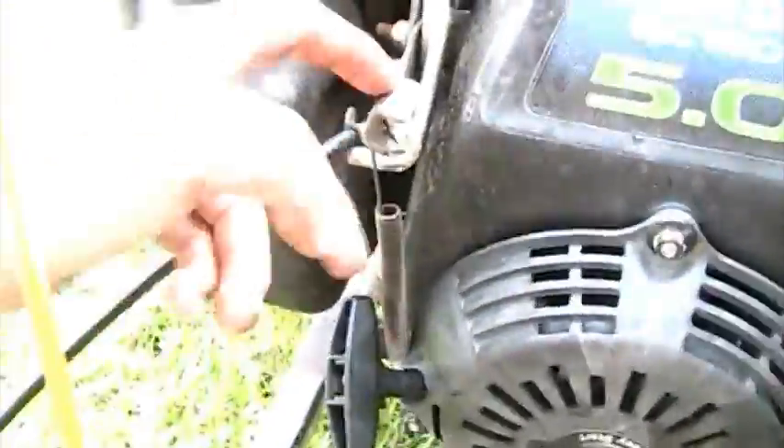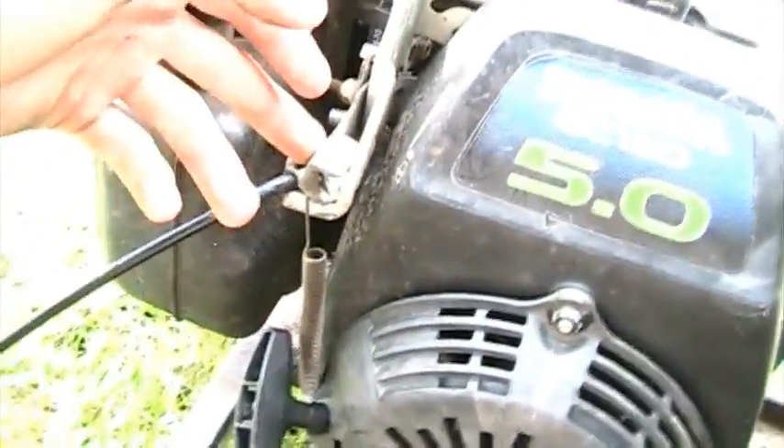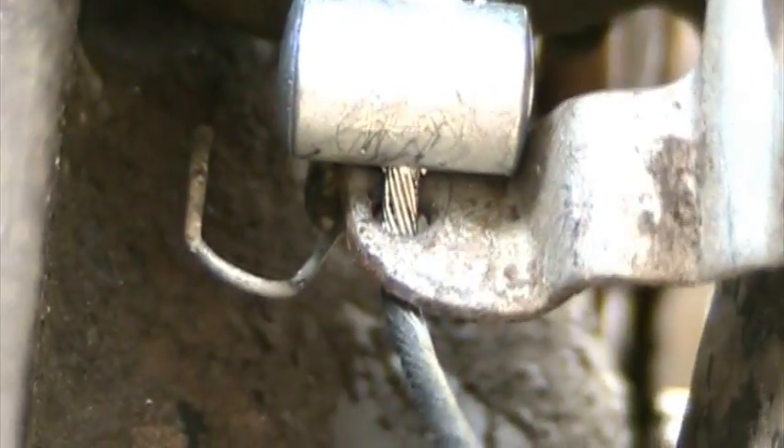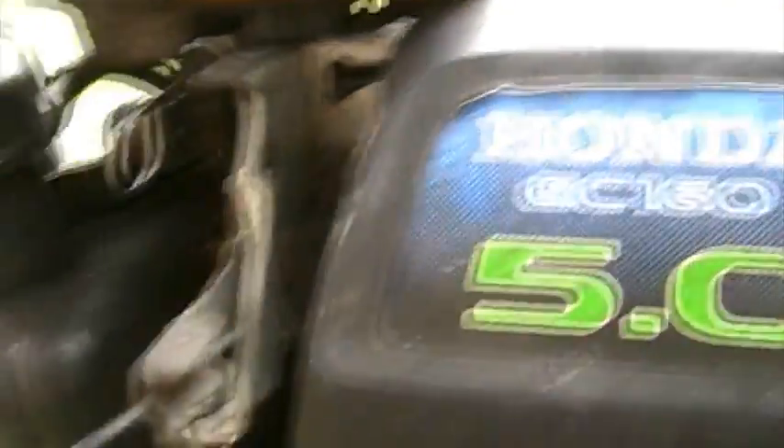Let me cut this key off because I don't want this thing starting. Now for the throttle — obviously you can't run a regular cable through the throttle return mount because the cable pulls the wrong direction. So what I ended up doing is I drilled a hole through there just big enough for a piece of flex cable to fit through. I drilled a hole there and I have that big bulbous cable end on there. That's how you do one of these motors up for a go-kart. Don't mess with the governor — you don't want to run anything straight into the governor because you can seriously damage the motor. You run it into the throttle, into the accelerator, and this motor will run at 3600 RPM.